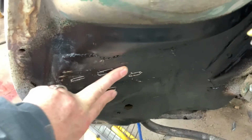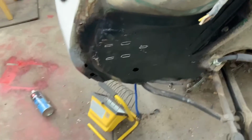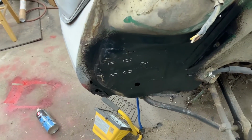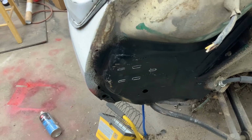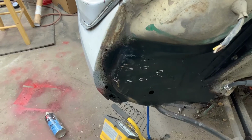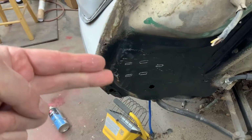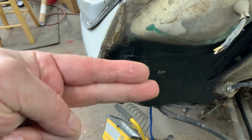And it welded, there was a channel, almost like the frame, a channel frame in there. And so that was rusted right up. I cleaned all the rust off of it. I cut out all the rust around it, and then I welded that right into the channel. And so I believe that once I weld it into the channel, it is nice and strong. And then I put the tin over the outside.